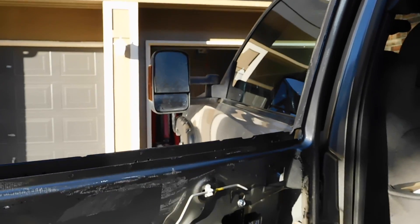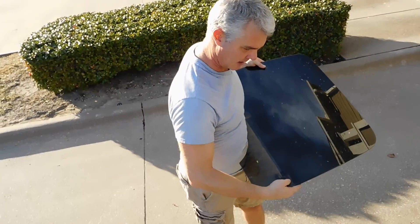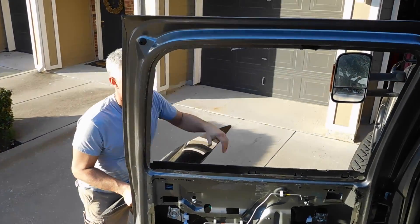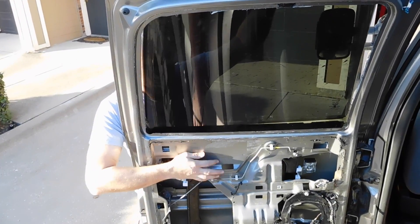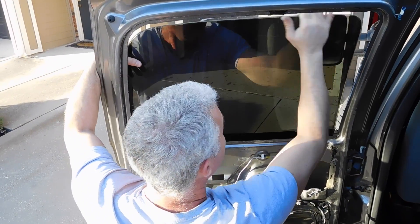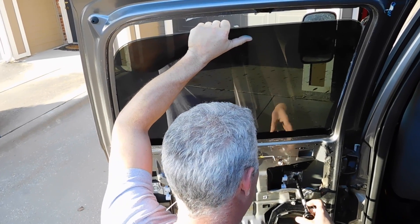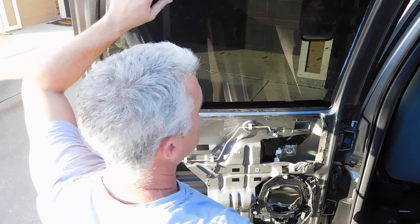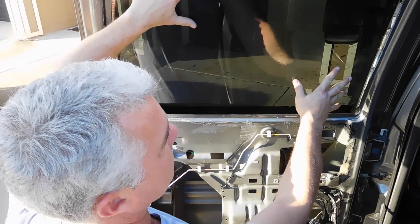Here's the fun part — dropping in a very expensive piece of breakable glass. This is what a piece of glass looks like outside the truck. All you see is from about right here up — it goes down inside the door. The trick is to get it down in here without breaking it, and get it into these little mounting spots. I guess I did not loosen these enough. The key is not to tighten these little bumpers or resting pads until you're sure everything's perfect.